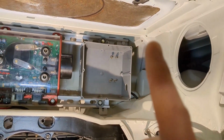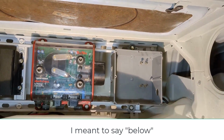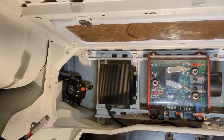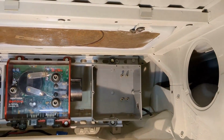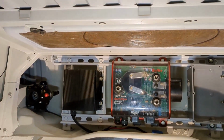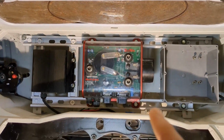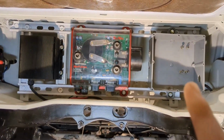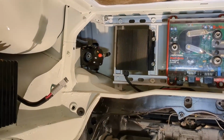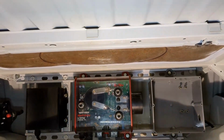But that will be to mount a board just above the hatch lid here with about 2 inches of space. And basically I'm going to have all of my DC, low voltage DC components, relays, terminal strips, terminal blocks, fuse blocks, all that stuff is going to be mounted up there. And because so much relies on the wiring for the 12 volt, all of those 12 volt pieces will be coming off the ceiling there and tapping into, like the DC to DC converter and all those different components. So that'll be perfect to have up there on the top there.